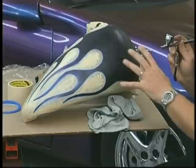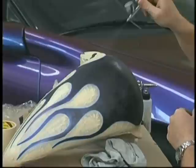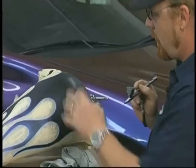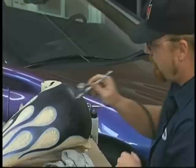And the nice thing about the airbrush, it's one of the few ways, as far as I know, almost the only way to get these very, very subtle gradated effects using the chameleon. Many people don't realize how transparent the chameleon really is. I could have an entire mural on here, and by slightly fading the chameleon over it, it'll give a complete chameleon effect to the mural, but not affect any of the detail of my mural.